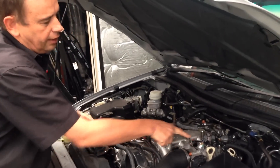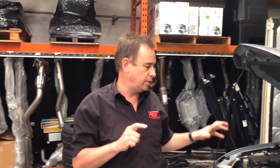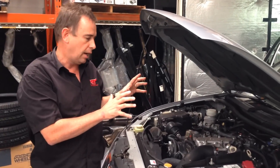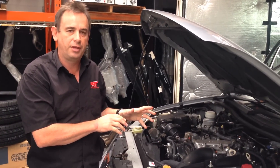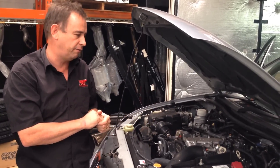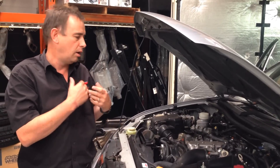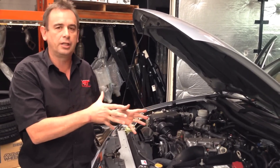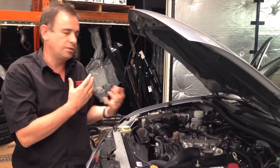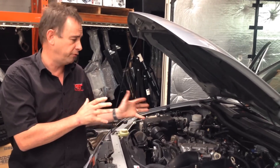If you look down inside this inlet manifold, this part here is actually quite clean, which means that pipe doesn't get blocked with any of that soot. This particular car has also done a big end bearing. It's done between 70 and 100,000 kilometres and has really bad soot in the inlet manifold. We think it's done a big end bearing because of the poor signal to the MAP sensor, or some other reason that caused it to not run properly.